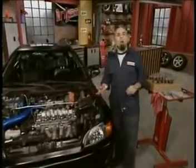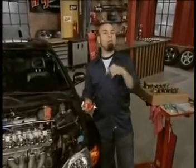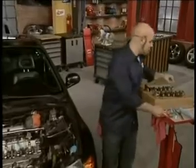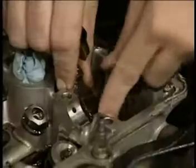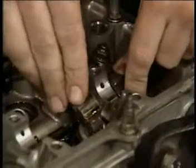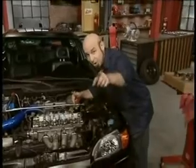When you get all the springs swapped out, drop a little dab of assembly lube on the top of all the valve stems. Then we can start putting the engine back together again. We're going to start with the rocker arms. Now, when you're putting these back in, give them a little inspection, make sure there's no wear on them that might score the new cams. I'm going to finish this up, and we're going to see you back here in a few.